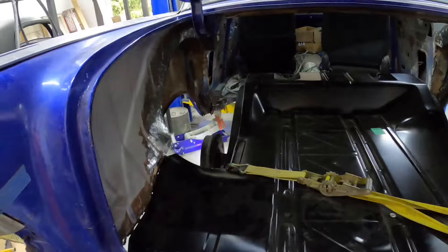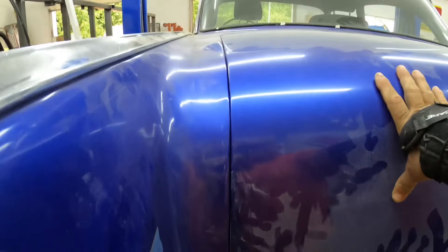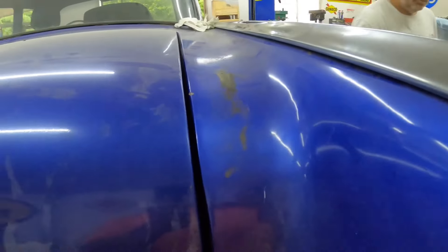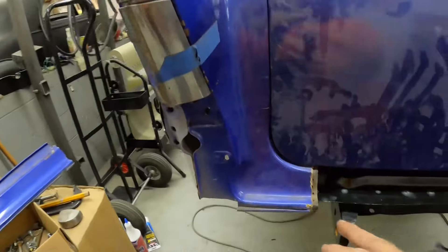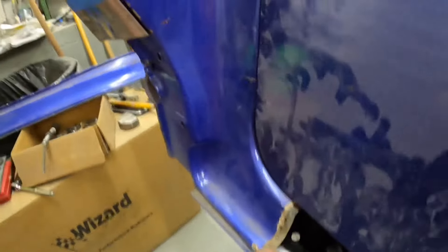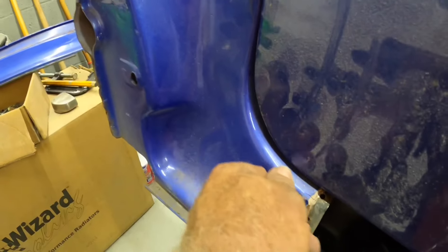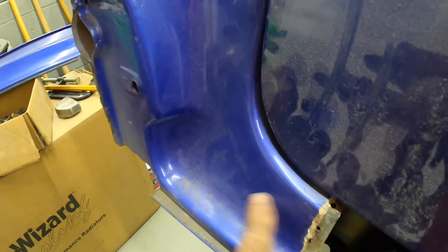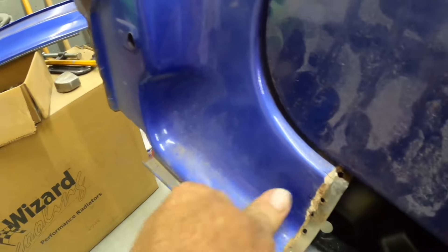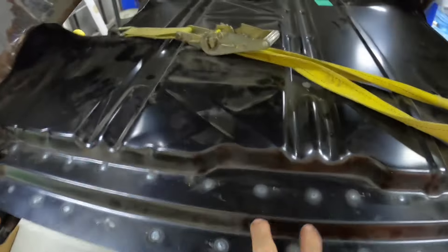We know we've got a decent straight line up here, but it's got to go across that amount. So we're going to move the trunk lid next. These areas here are full of bondo - look at how much bondo there is in there. This has had a replacement section on there and we don't think they're in the right spot. We're going to have to find out exactly where the steel is and get it fitting properly. Same with this side - the quarter panels are loose at the moment. Once we get that right and ready for the tail pan, we'll make a couple of braces from the back and set up the lock and latch.